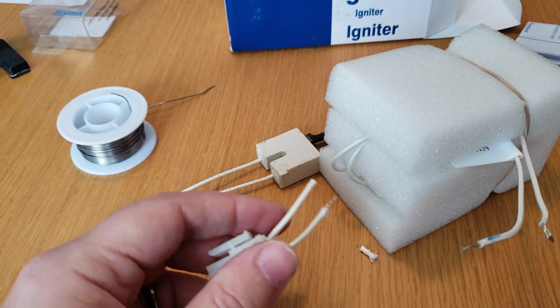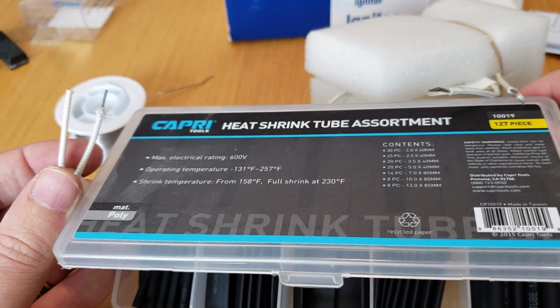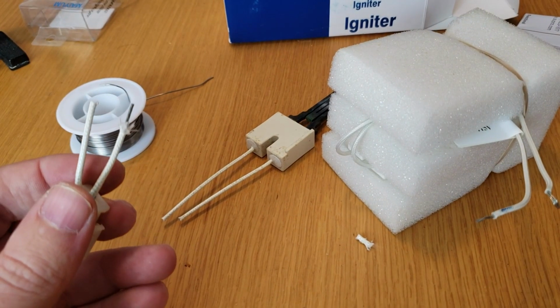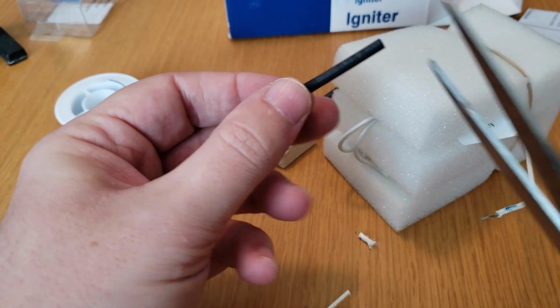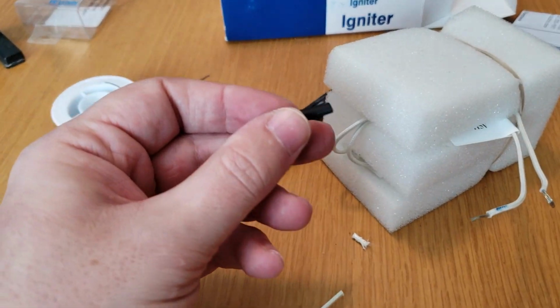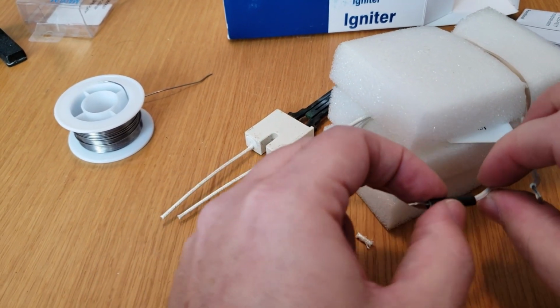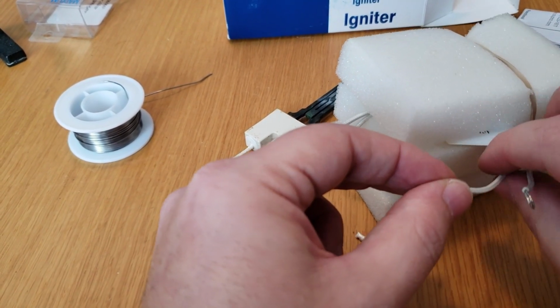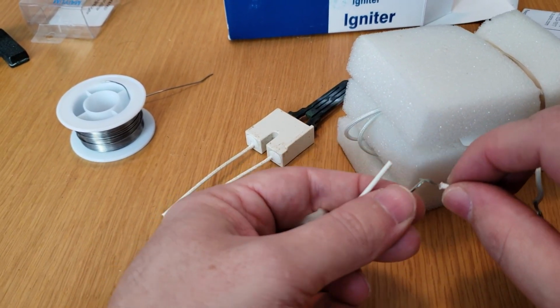So if you buy one of these little kits, it's got a little shrink tubing. I think I got it at Harbor Freight for not much. Get a piece of shrink tubing. Let's cut this in half. I need the whole thing. All right. Make sure you put that on first, otherwise you're going to be bumming later on when you have to undo your solder joint.